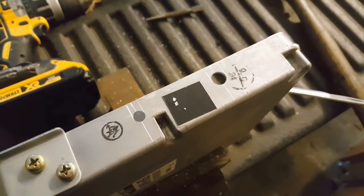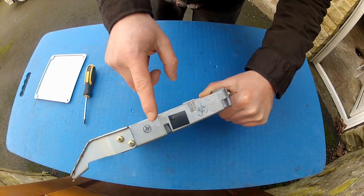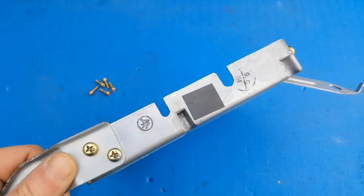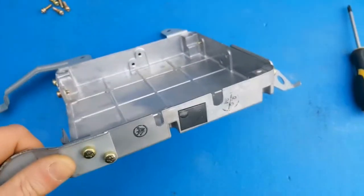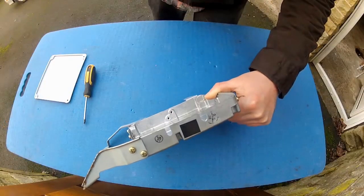That's my two holes drilled — one for the MAP line, one for the tuning cable. I've also cut slots down to them with a hacksaw, which will allow me to install and remove the ECU in the future without having to unplug the lines first.